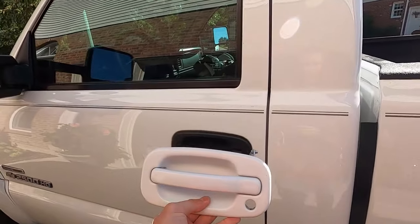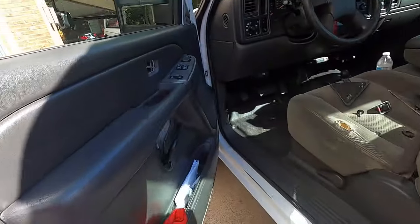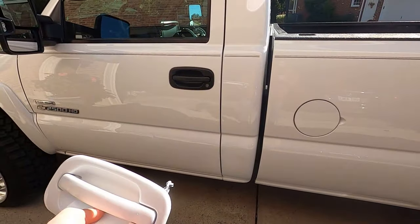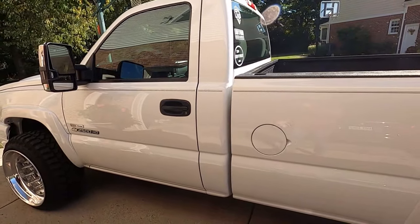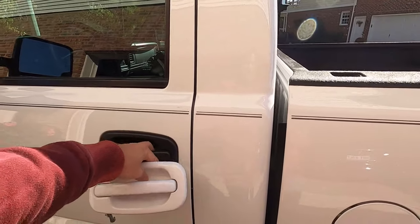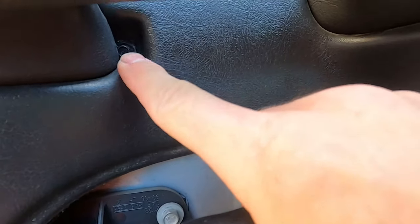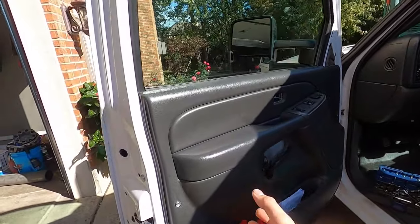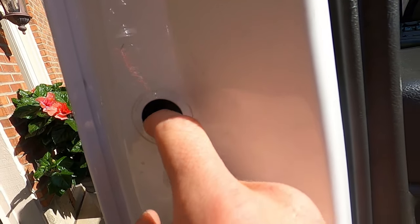The day has finally come — I've grown some motivation to put these things in. It's going to be super annoying to take the door panel off and mess with this from the back side, but I finally wanted to get this done. You need an 8 millimeter here, an 8 millimeter here, and a Torx T20 here, and then we should be able to pull the door panel off enough to get behind it. Then you have to pull the grommet off on the door jamb to get to the nut for the door handle.